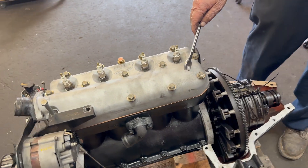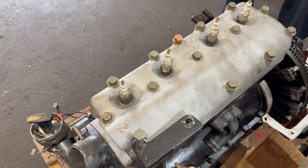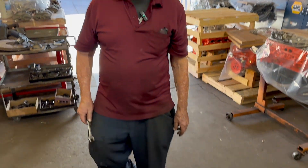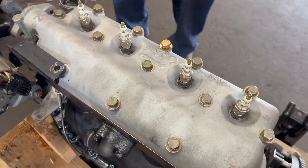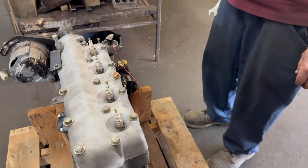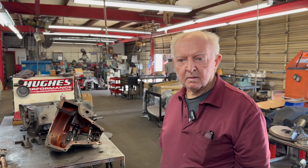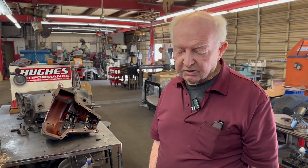We're putting on an aluminum head instead of a cast iron head. The original head is over there — it was cast iron. This aluminum head is a little bit more compressed, more compression, so maybe it has a little bit more power. That's more compression from the head in addition to more compression from your longer stroke. So you've got a few things going on. It originally put out 20 horsepower new, and we're trying to get 40 on the same exhaust and intake. I think we can do it.